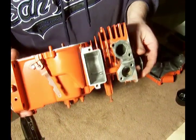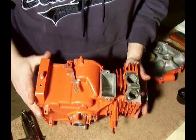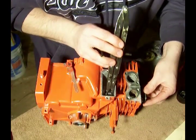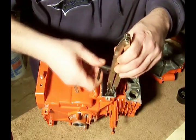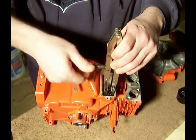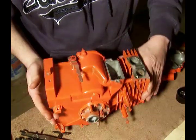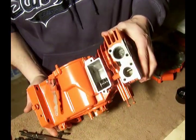Now, if you look inside, you'll see where the valve comes through the hole. Back it out just a little bit, and then we'll go put the spring in there, with the keyhole washer toward the bottom of the engine. Once the valve is in place — well, it came apart on me. Hopefully that will stay put. And there we go — the valve is in place.